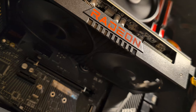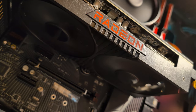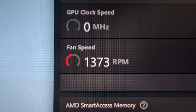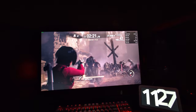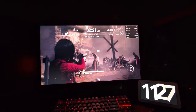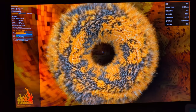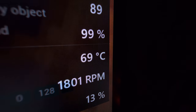I installed the drivers and checked that the fans were still spinning — the drivers weren't getting in the way of the fan spinning at all. So I was thinking maybe it's a thermal issue, maybe the fans got too hot or something. Computers do weird things sometimes. So I put it on Resident Evil 4 remake at 1440p prioritized graphics, and everything was running fine — temps were pretty decent, nothing out of the ordinary. As a final test, I put on FurMark and let it sit for about an hour or two. It reached a very nice number, so obviously the thermals are good and the fans are fine.